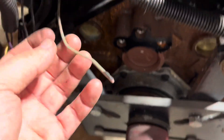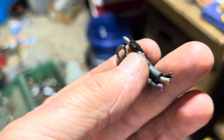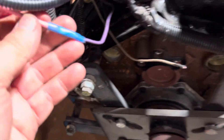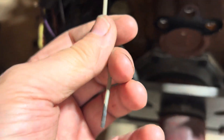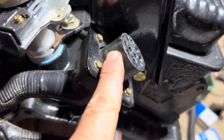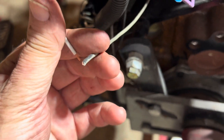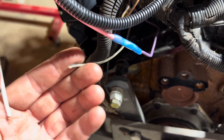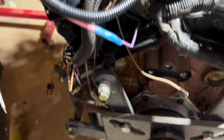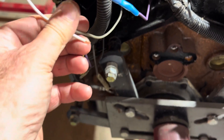That leaves two more wires — a purple and a gray. I had ring terminals on the purple and gray; I cut those off. In the kit I provide a 14-gauge butt splice to splice the purple wire into the pink wire for your new coil connection. The gray wire is your tach signal now — it goes to the tach signal input and to the white wire coming off the new Delco EST coil. I'm going to make that connection last, after it's in the boat and running, because the tach isn't even connected until it's in the boat and I don't want it to possibly stop the engine from running.